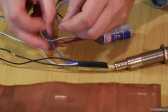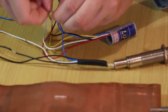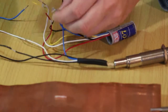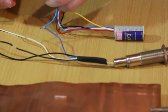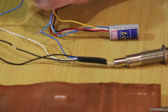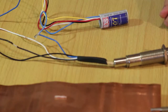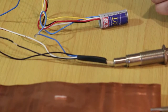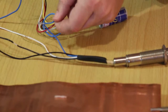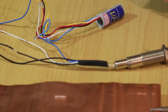The blue emulator wire is the input signal; we connect it to the oxygen sensor. In this example I will not insulate, just show how it looks. The yellow wire is the processed output signal heading to the control unit. If you have a non-functioning oxygen sensor, you can take the signal from the front oxygen sensor, provided it has a signal ranging from 0 to 1 volt.